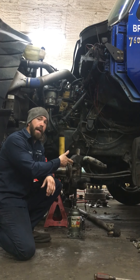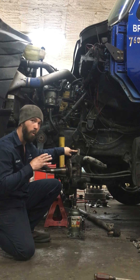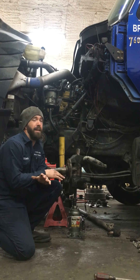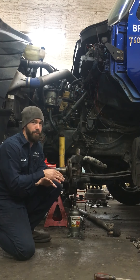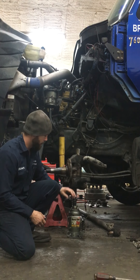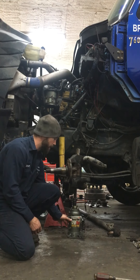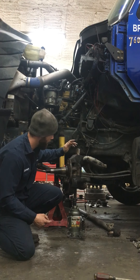So I'm going to try to stay out of the way of everything I got going here. As you can see, my setup here that I got to drive this kingpin out. By the way — kingpin — a solid piece of metal that if you do not grease, or shim it too tight, shim it too loose, put stupid bearings in there — regardless, lubrication is the key to a lot of trucks, man. If you want to help yourself from any kind of headache on repairs like this, it makes it so much easier and faster. This guy had grease, so that's good. I've got a simple 20-ton bottle jack here. I had a block of wood underneath so that I could set it right on the bottom side of the kingpin.